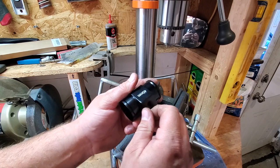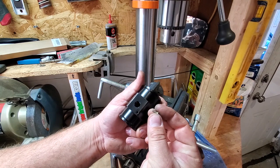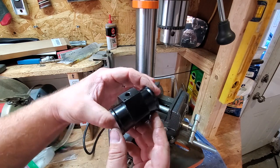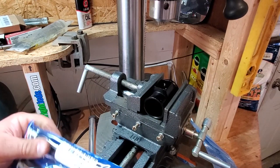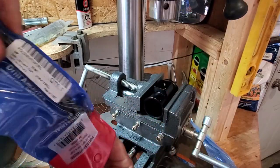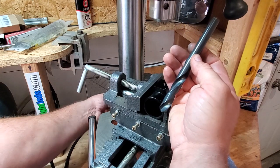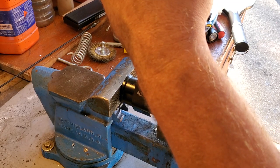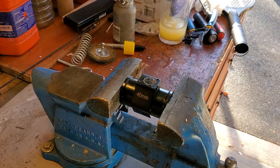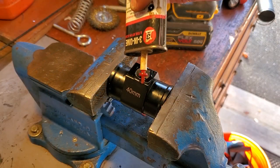Here is our fitting — this should work perfectly in the midst of our upper radiator hose; we'll find a place for that later. I'm just going to take out this little screw, we won't need that. I'll put this in the vice. I took my bit out of the sleeve and quickly realized that with my XY vice attached to my drill press, the shaft is not long enough to accommodate this big bit, so I'm going to have to resort to the vice. The hole came out very nice.